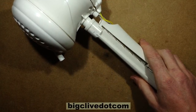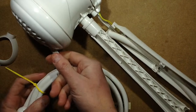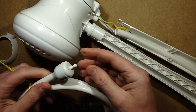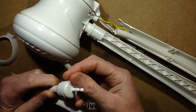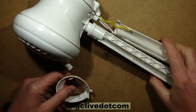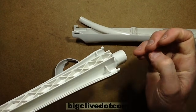There's also this little thing here — it's a hose which I originally thought was the bit that supplies water to it, but it isn't. This goes on to this outlet here, and it relieves the pressure if the output ever gets blocked up and the water boils or something like that. It blows a little plug here and just squirts the steaming pressure out through these holes to diffuse it a bit, just for safety. It's got this little bit of plastic trim that goes against the wall, but it needs that threaded insert in the wall for you to actually screw this into that's plumbed for the water.